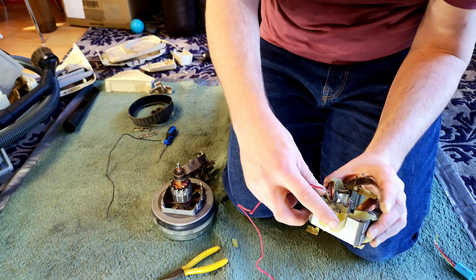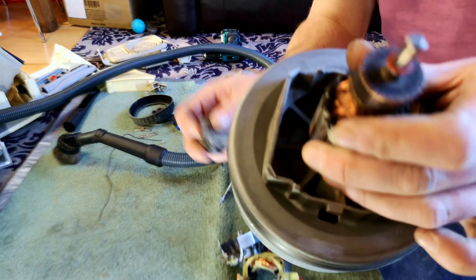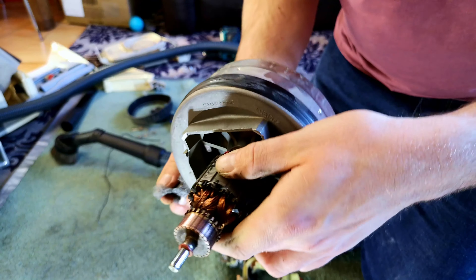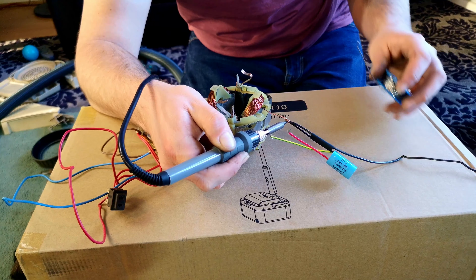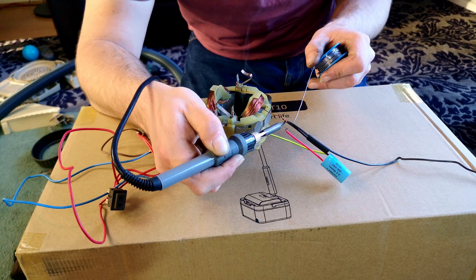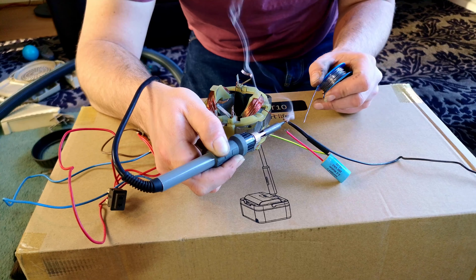What we're doing instead is basically my mod — just soldering wires together. Then we take the commutator on its armature and clean it; I use double-zero or triple-zero gauge fine wire wool — you're only knocking the black oxidation off anyway, and eventually you'll have something that looks a lot better and shinier. Then we start to hash together our wiring. I only have one coil wire to play with — do I just connect two wires to it and everything will magically work? I have one last suppressor, so we'll get the heat going into this joint properly, rob it with solder, and hide all our evils with heat shrink. Marvellous.